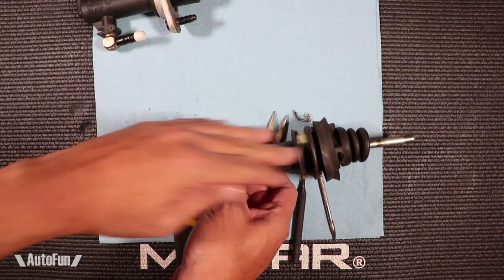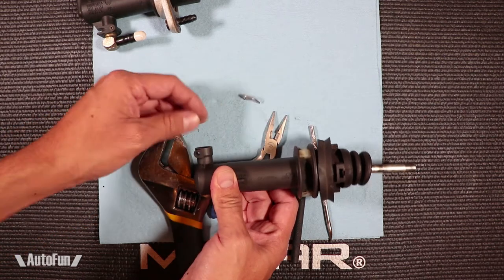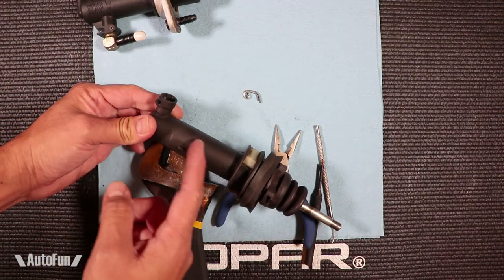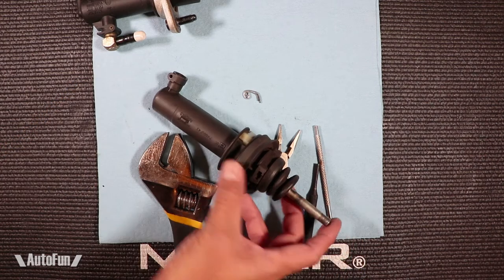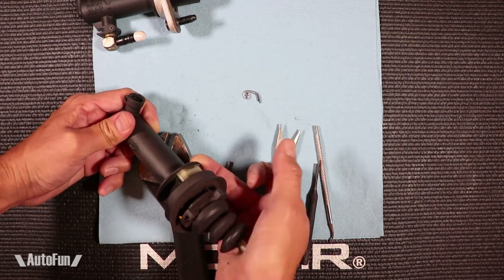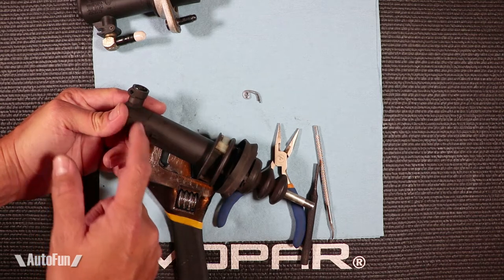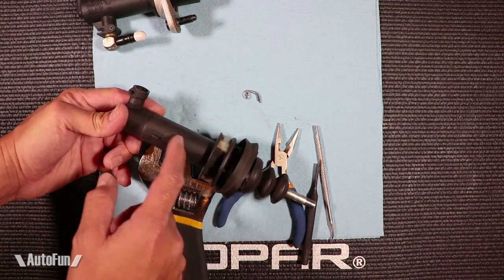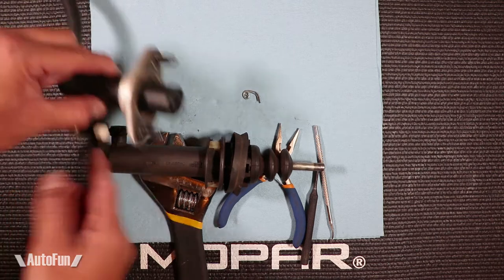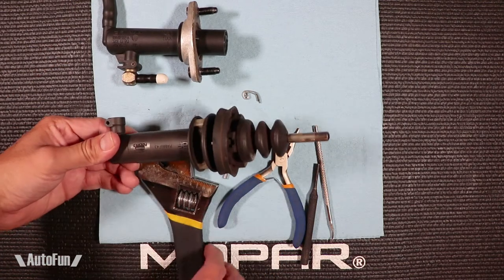The factory describes that the slave cylinder can be replaced on its own. You would push out the roll pin, remove the cotter pin, swap it out, connect it back again, and then the fluid will fill the slave cylinder. From the bottom of the car, the factory manual describes that you will have to press this several times — as you pump, you're displacing the air that's in there, the fluid is filling up the cylinder, and the air travels up the line into the master cylinder, and from there the bubbles keep traveling out to the reservoir.